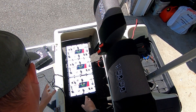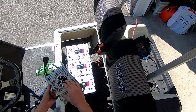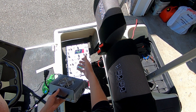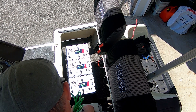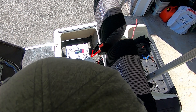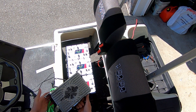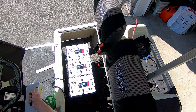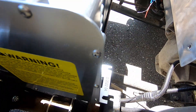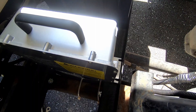I've come to a point where I'm looking at where to mount this charger. I'm thinking I'm going to mount it over there with the fan facing away from the battery so it's going to be able to dissipate heat. The only problem is, to fit inside the rail this way, the base is too wide. So I'm thinking if I cut this little piece off and this little piece off, then it's going to be able to sit down inside the rail. Okay, now you can see that fits perfectly. I cut a little off of this end, and now it fits perfectly down on top of the rail here. I'll mount that on the other side of my batteries.